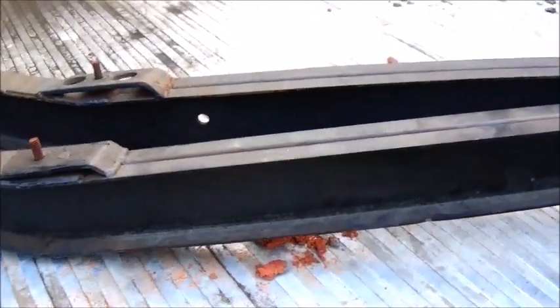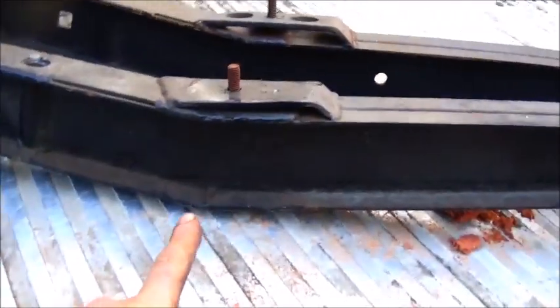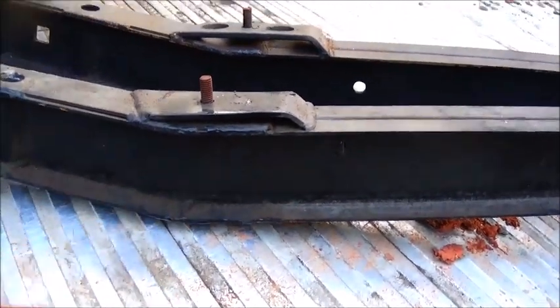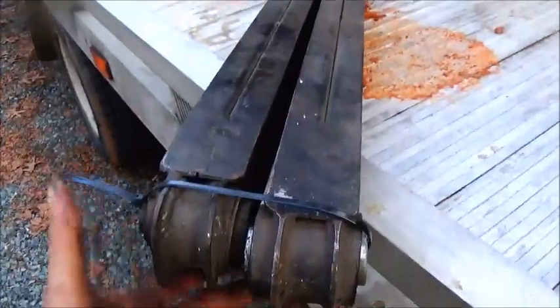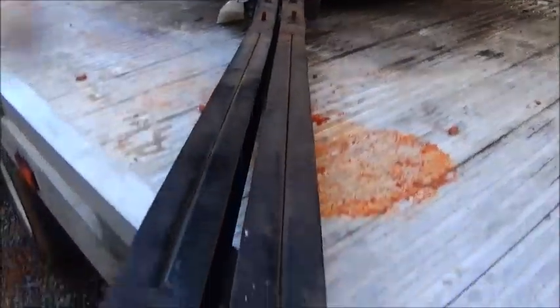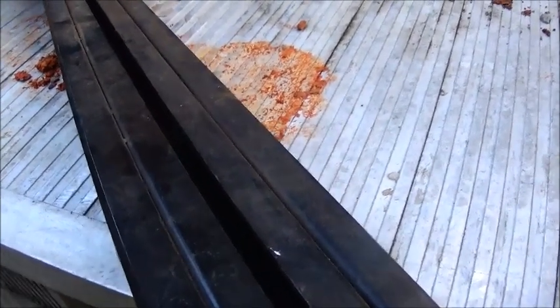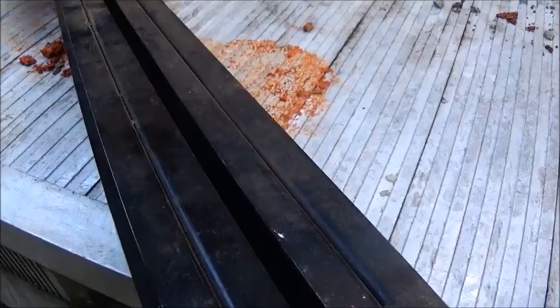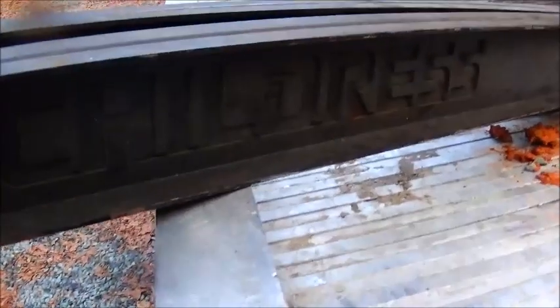Here's the set that he had. Built the same — basically I-beam construction, two separate ones put together. The difference is these have got a little bit different, slightly higher angle on them, but they bolt in the same way. They're actually straight — spread about the same distance, just straight bars. No different than a ladder bar. The plans was to use stock stuff and this is as close to stock as you're going to get for a 64 GM truck.